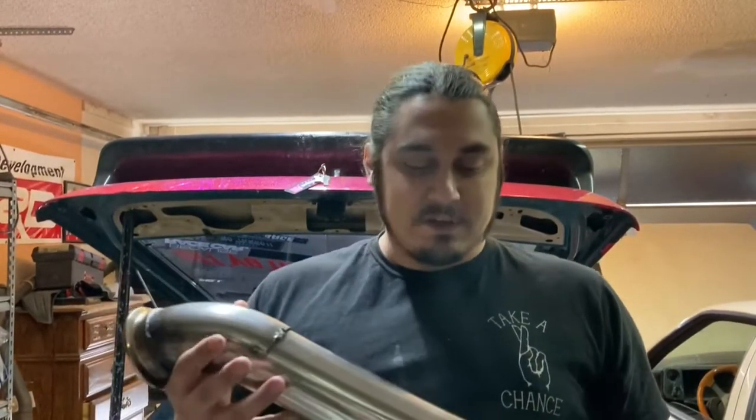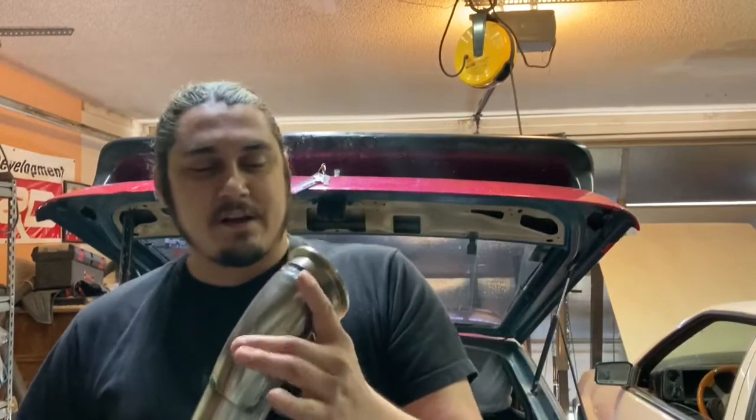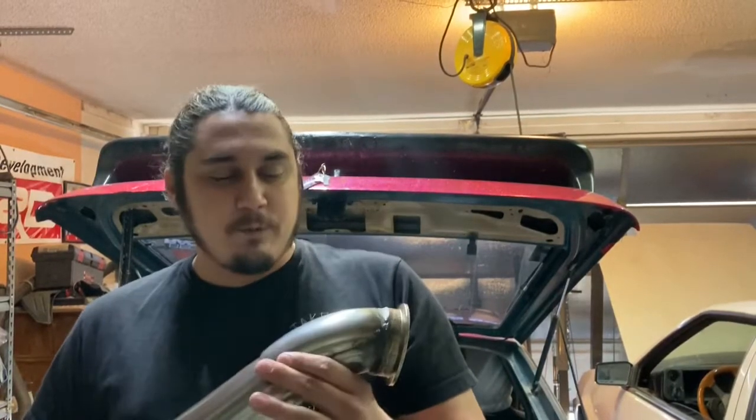Part of the issue is the exhaust manifold flange sits a little low, so it kind of forces the exhaust to make a sudden bend here, and it's funky. So you're kind of fighting it as it is. So I wore through this part of the pipe. I'll insert some video, and I wore through the flex pipe here. So as a precaution, we did go ahead and add an extra layer here of skin and material. So if I do jump curbs and stuff and hit this and scrape it, it offers a little bit more protection than just the one single wall there.